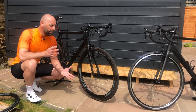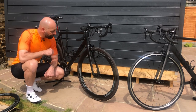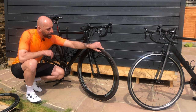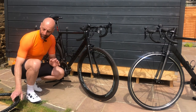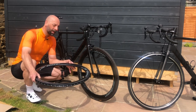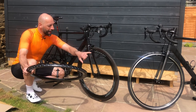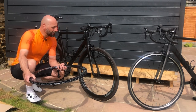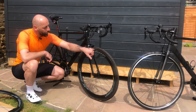Overall it won't impair my enjoyment on the wheels. The front wheel has stayed very, very nicely — the brake track even after 10,000–11,000 kilometers (7,000 miles) does not show any sign of wear. Since I'm riding rim brake, maintenance of the brake track is paramount. I clean both the pads and the rims if I've ridden in a dirty area or in the rain, which I try to avoid on this bike — you don't want debris ruining the brake track surface while braking.